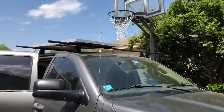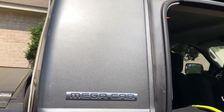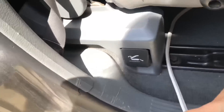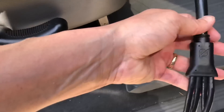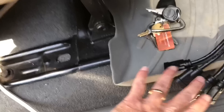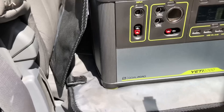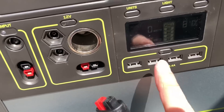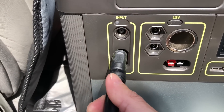Here is my truck with a 165-watt solar panel on it. If you've seen my other videos, I have 10-gauge wire routed from underneath the truck going to a Goal Zero Anderson port combiner — it can combine up to four inputs into one. Right now I just have one panel connected, with electrical tape securing the connection. I'm going to plug into the Anderson port on the PWM controller and we'll see the reading.